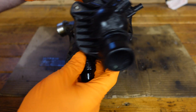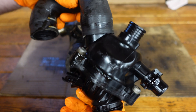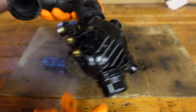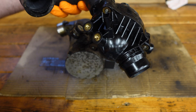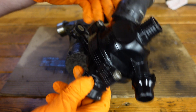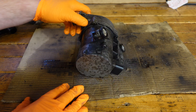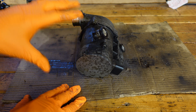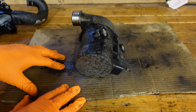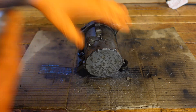You can see it was quite bad and oiled up — they're still oiled up. This is the old thermostat, the old hose, and obviously I've replaced those. We're not really going to tear the thermostat down — you know it's going to be a thermostat with a spring that opens and closes as needed. The main thing we're going to be focusing on is this water pump, so I'm going to get the tool and start removing everything to find out how it failed and what it looks like inside.